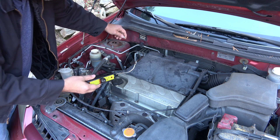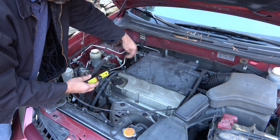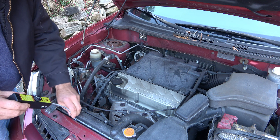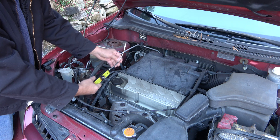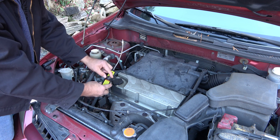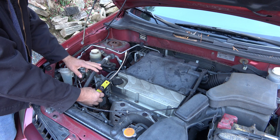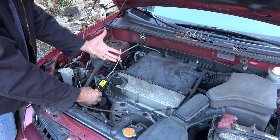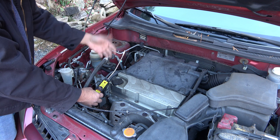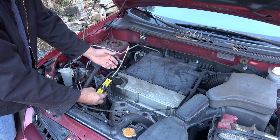Right away — and that's pretty much exactly how this works. Obviously that's an obvious source, but you'd want to check around your crimps, around your condenser both above and below. You'd stick this into the EVAP drain and check up there to see if it catches a whiff coming out of the EVAP. A lot of cars have EVAP leaks. AC dye is going to show up on, say, a hose that's leaking — you get a UV light and check it with AC dye. But an evaporator, you're not going to see dye leaking out because you can't see the evaporator. So, stuck in the EVAP drain line, you run the car, let it get up to temperature, AC full blast, shut it off, let it sit for a few minutes, stick this up onto the vent line and it should catch it because that gas is going to filter down through that little EVAP port.